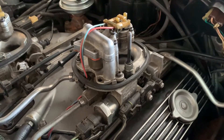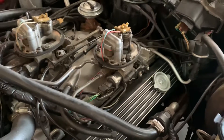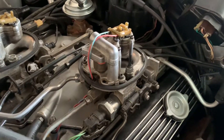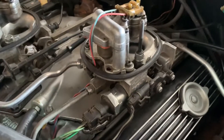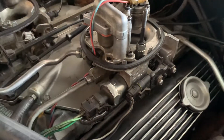It's kind of like what was on a factory Quadrajet — an 80s Quadrajet that blocked off the idle mixture screws. It's just a tamper-proof plug. That can be knocked out with a small screwdriver and a small hammer. Once you get that plug out, which is right under here, that's how you get to it.